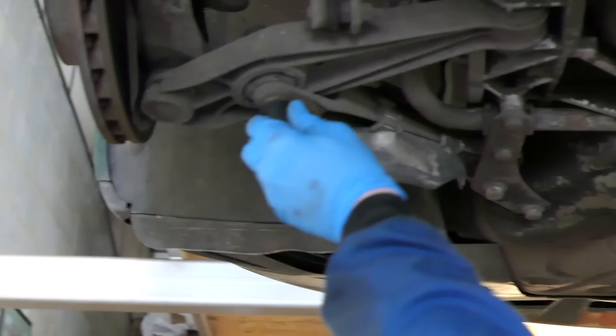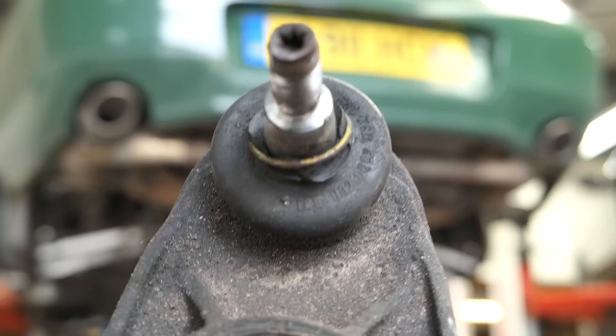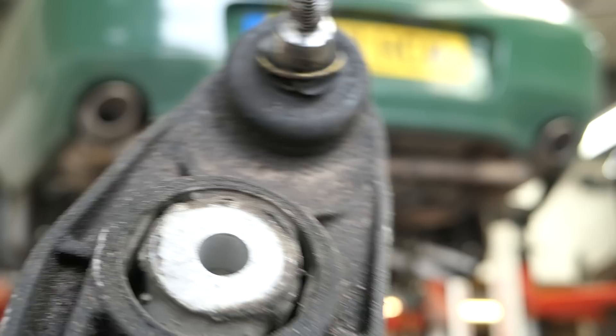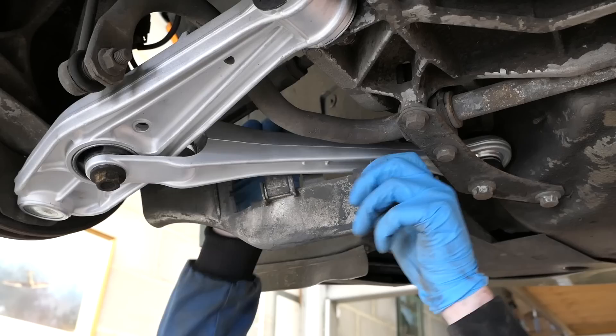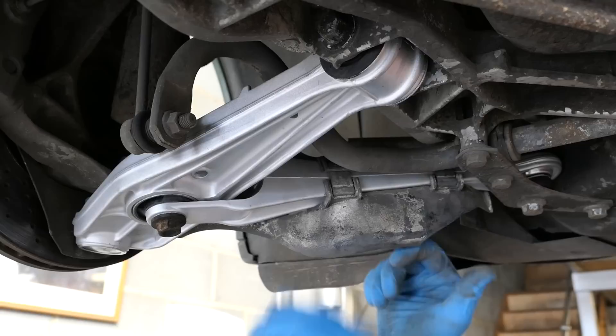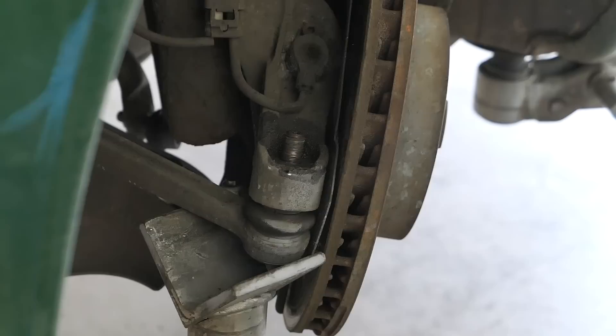With most of the rear replenished, the guys fastened the anti-roll bar and put the 996's middle undertray back up before moving to the front, where Joe was quick to offer a professional synopsis on the general state of play. The front arms proved more tricky to remove than the rears, and once off, the cause of all the creaking became clear — the ball joint was severely perished and the middle bushing was delaminating badly. Both would have failed their next MOT. Much-needed new lower arms and tuning forks were put on, with Joe also swapping over the original brake air feed — these often get lost over the years but do a vital job, so check your 996 still has these. Finally, the tired track rod ends were swapped for TRW items, who were the original equipment manufacturer for much of the 996's chassis parts.